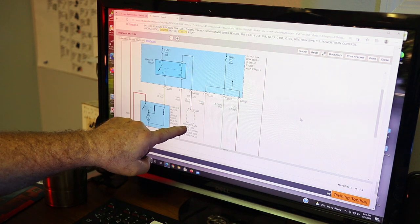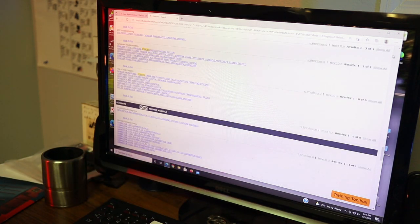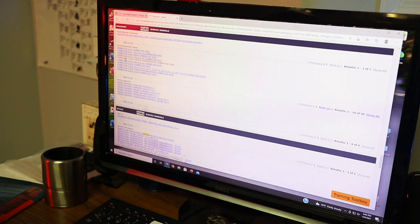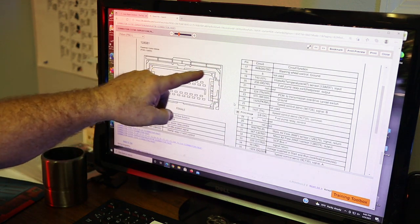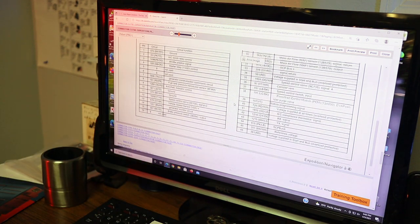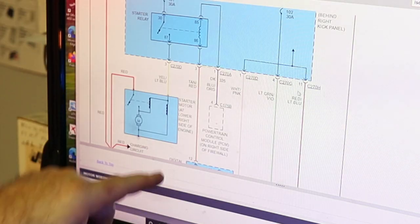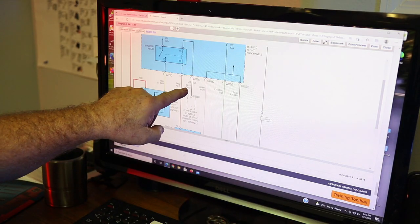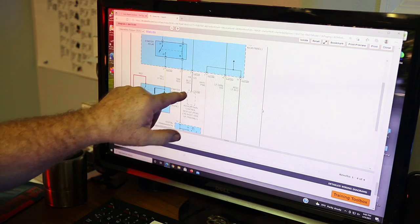I was only missing my ground. Following the wiring diagram, I can see the powertrain control module supplies the ground. I went right to the PCM at connector C175B — the connector all the way to the left of the PCM. In Identifix, I can look up the connector and see pin 4 is dark blue and orange, labeled 'start relay control.' Using the component locator, C175B shows the PCM is right next to the battery — first connector all the way to the left. I tested that connector and found I did have a good ground coming out of the PCM.